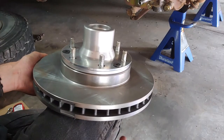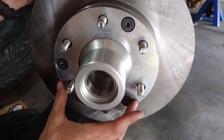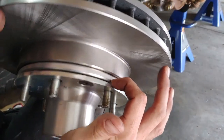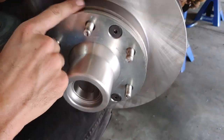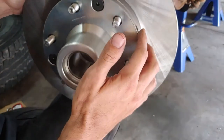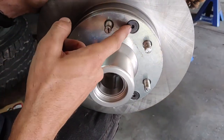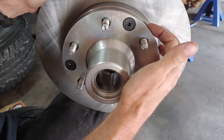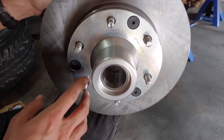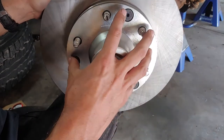Next, install the hub to the rotor and press the studs through. One thing to note: on this wheel spacer there are three holes that go through the hub — the middle piece — and into threaded holes in the rotor. The pre-drilled holes in the middle piece were a little too small and slightly off-center from the holes on the spacer, so we had to drill them out. The holes should be 3/8 inch, but we went just a hair bigger — a 13/32 drill bit — to make sure we had adequate room.